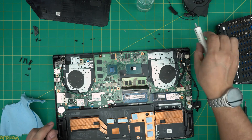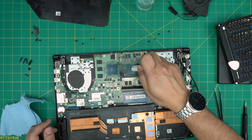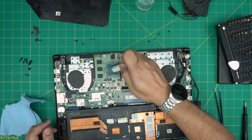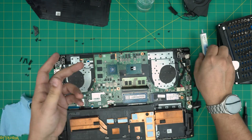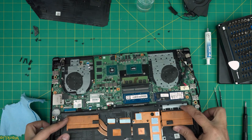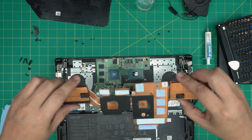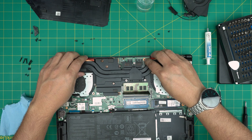Now all you want to do is put a tiny line of thermal paste on the CPU and one drop right in the middle of the GPU. Don't worry — it's going to spread around on its own. It's not conductive so don't worry about putting too much or too little. That amount is enough; it will just spread itself around. Then grab the heatsink and bring it down.